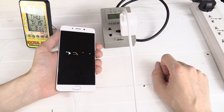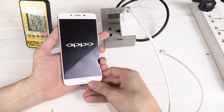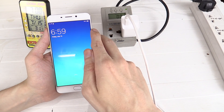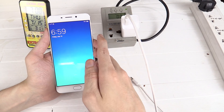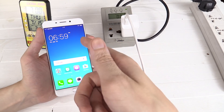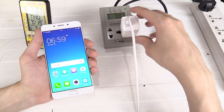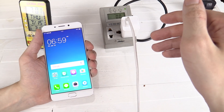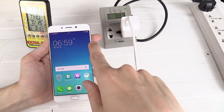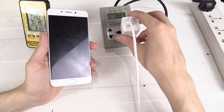Okay, I'll disconnect the charger — that's our full 30 minutes. Let's see how much power we managed to push into this thing. 68 percent — not quite 75 percent, but pretty close. That's pretty darn good: 68 percent in 30 minutes. A lot of other phones couldn't manage that. Once you get to 75 percent, the charge rate will be slower — you saw it was managing to draw nearly 20 watts from the wall earlier. But for that first 30 minutes you really are going to charge this thing super fast. I could now go out with 70 percent battery, which would probably last me for a day if I was careful. The VOOC charging really is quite impressive.